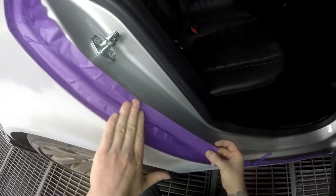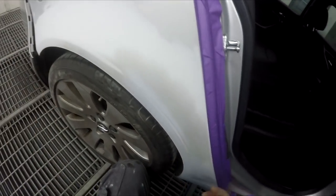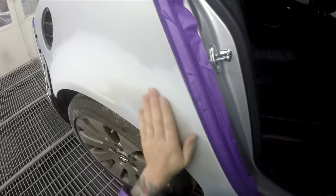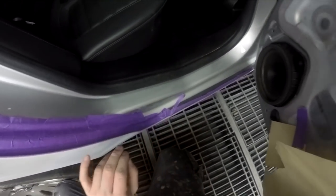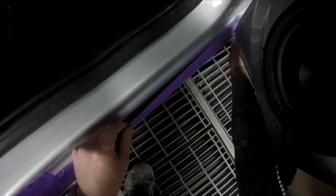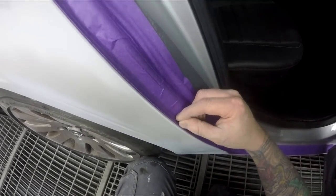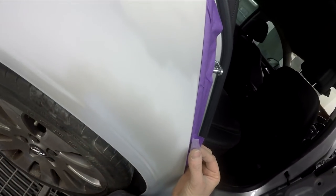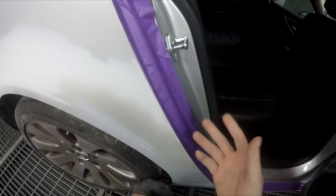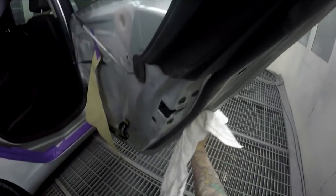This is why I don't like using non-sanding primers — or what they call sealers in America. A lot of guys over there in the US would just put sealer over their primer. I prefer to get that primer knife-dry, sand it out, and as you can see here there were a couple of spots I did cut through — some UV primer, some 1K etch primer — I'd rather do that and get the prep on point. What can happen with non-sanding primer is it creeps through here a little bit, but then the silver won't follow it and you'll be left with an edge. I've heard of people running a piece of tape down the gap, but I can still imagine it building up on that tape edge — especially on a silver. At the end of the day, do what works for you, but that's just the way I do it.